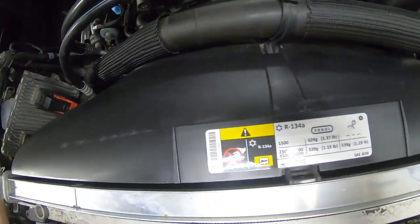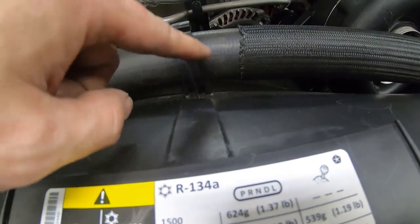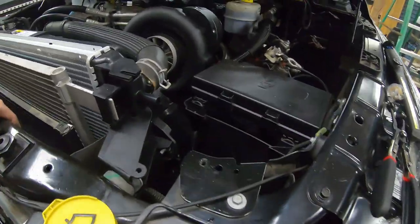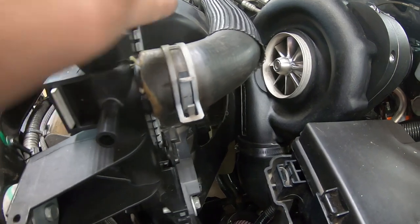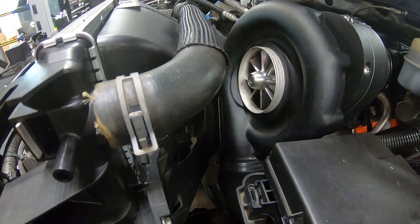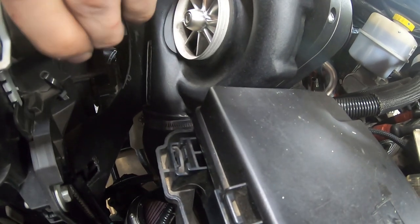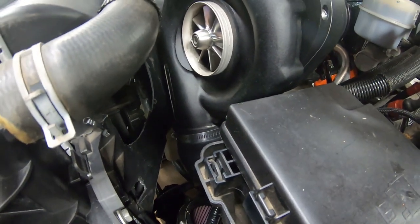So you can see we've got the upper part of our shroud in place, along with our coolant hose. In this particular case, the upper part of the shroud serves as a supporting mount for the upper radiator hose. And one of the things that Procharger has you do is that this hose is actually an inch longer, but if you left the factory length on it, it would hit into the supercharger on this side. So what they have you do is actually shorten this hose by an inch and then attach it. So I'm going to make sure that it bit all the way around. And it did. Okay, good. So the clamp is in the right spot, behind the little nub. So that's good. So what we're going to work on next is getting this